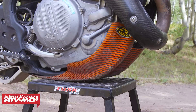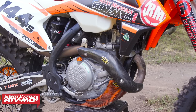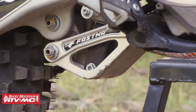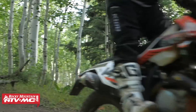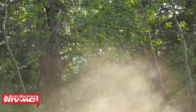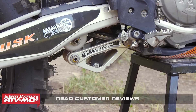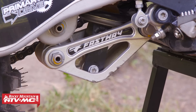Also on this bike, the four-stroke header actually has kind of an expansion chamber, and it's not as durable as the headers of old. P3 has this really nice guard that protects that as well. Moving on to the suspension, we've got the Fastway linkage, and it actually replaces the whole linkage on the bottom of this bike. Sometimes when you're hopping logs or running through rocks, that linkage sticks down too far and it gets hung up. Fastway makes this guard that is adjustable so I can adjust the ride height, and it's clean and simple. I've only gotten hung up on it a couple times — as you can see I've definitely gouged it — but it's worked exactly like it's supposed to work.